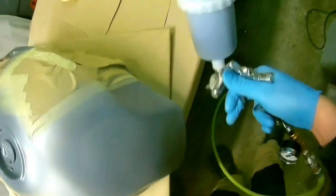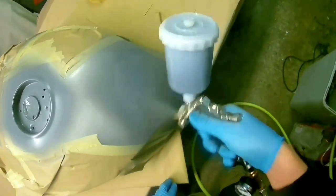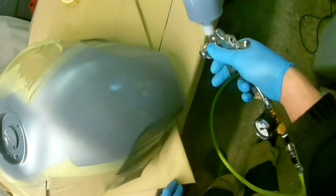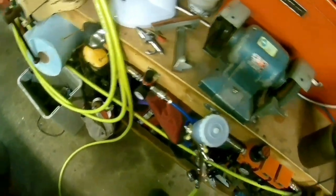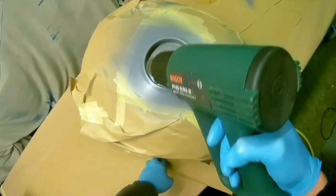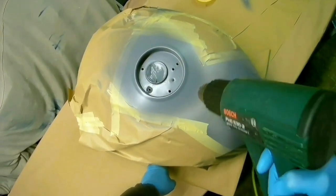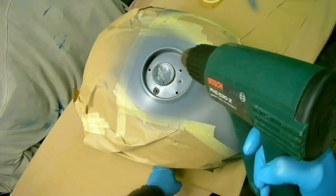You'll see I'm just doing the three parts needed: this little edge that had a dent which has been filled and sanded down, then this larger patch of filler because there were quite a few small dents in this area - I flattened it off, got the dents out as much as I could, filled it just to give it a smooth edge. Now we're doing various little bits of spot priming, keeping the lamp on it because it's quite chilly - about 10 degrees Celsius.